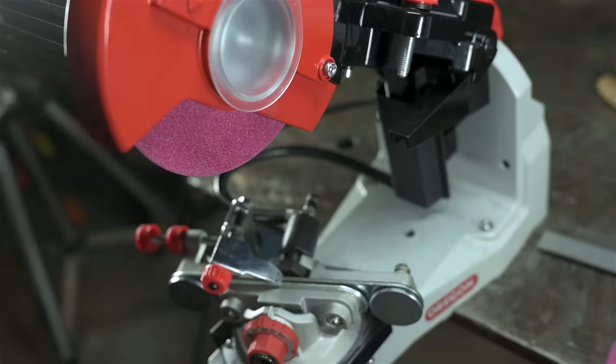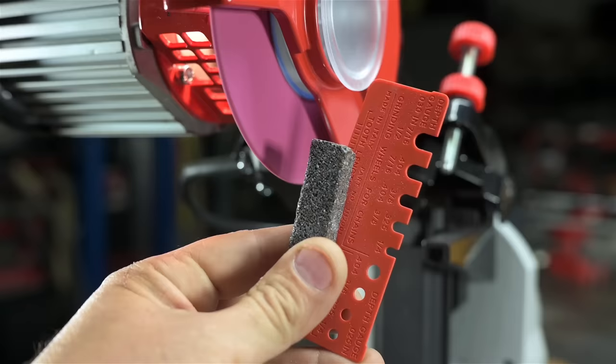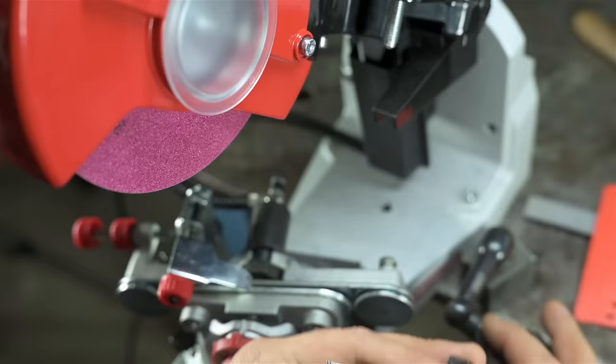I'm also finding that I like the thinner wheel more than the right-sized wheel. It comes with a little dressing stick and a radius gauge, so you can hang out and have some coffee and play Michelangelo shaping your wheels. The right profile is in there, you just have to liberate it. In fact, I might try to make a profile cutter, like a forming cutter, with some high-speed steel. Somebody write that down.